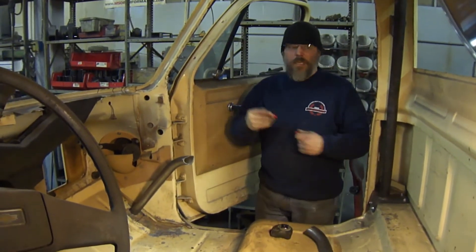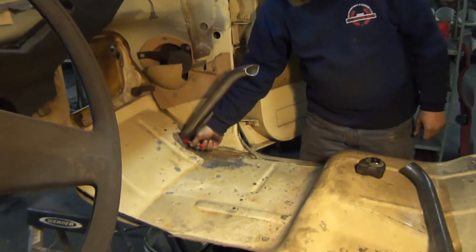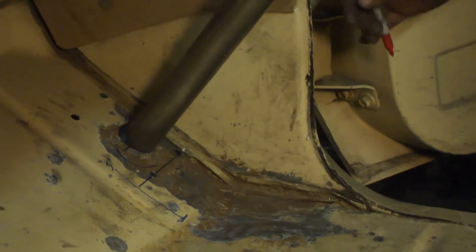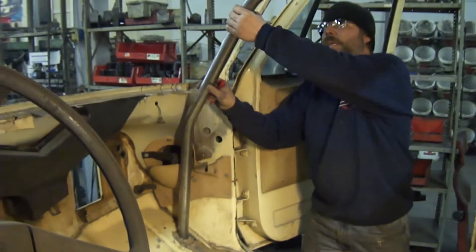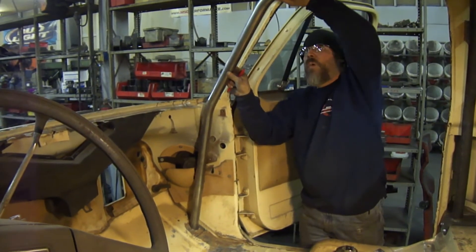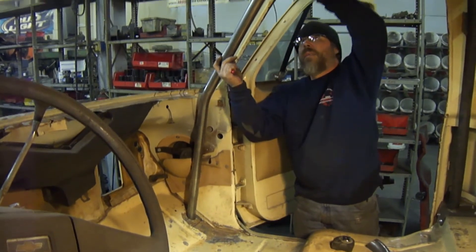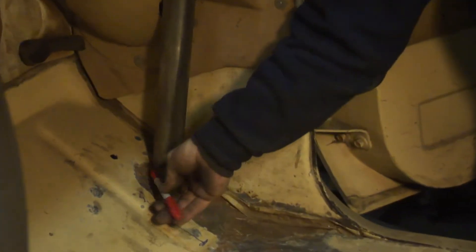In our previous segments, we did the B-pillar hoop installation and the halo hoop. Now we're going to finish things up with our A-pillar installation. We have our hole saw hole here in the floor that we're going to use to help us figure out the length of our A-pillar bar. That hole was five inches up, two inches out. By dropping your bar through here, you can bring it up — it's nice to have an extra set of hands to help hold this bar in place and get it fitted and make sure everything is the way you want it. All you need to do is mark out the floor where you're going to make that cut.